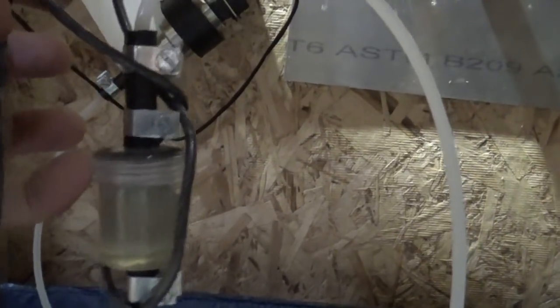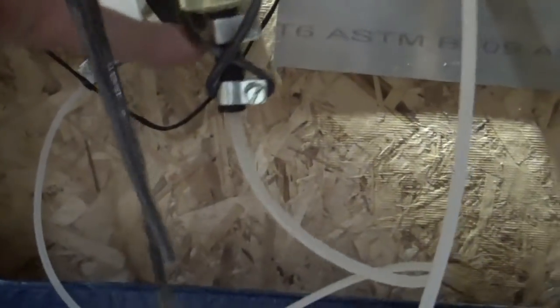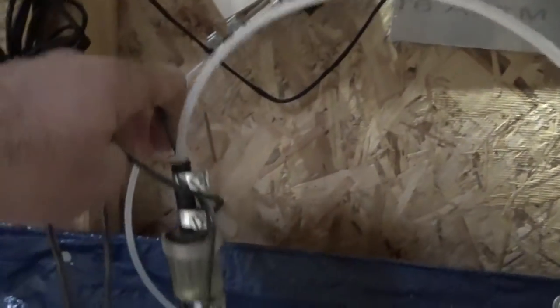Fuel filter. Make sure it's up and down like this. Alright. Screw on cap right there. It's at the top. Okay, all the air bubbles are at the top. All the fuel with zero air is at the bottom. Again, hose clamp, tube, fuel line into the tube. I just have some 10 wire here bent to make a sort of a rack for the pump to keep it straight up and down.